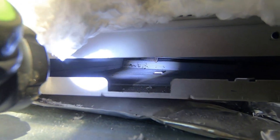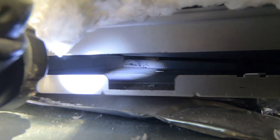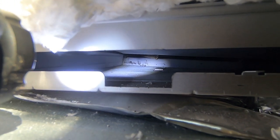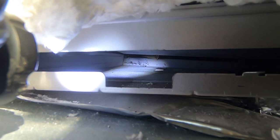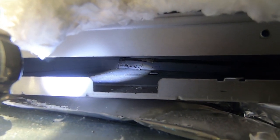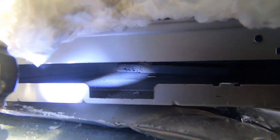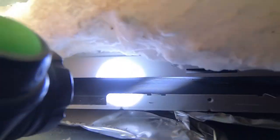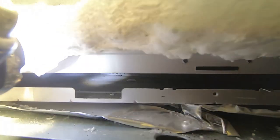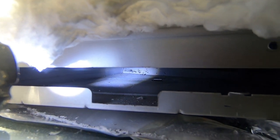Near the back there's a piece that looks like black silicone - that's a piece of the bake element fused right to the bottom plate. I've hit it pretty hard with a scraper and it wants to stay there. I'm not sure if it'll interfere with the new one when I put it in. There's no matching blob on the other side, so I know it's not supposed to be there. I'm going to try a bit more to get that blob off before putting the new element in.